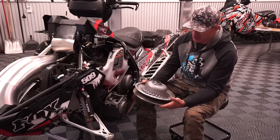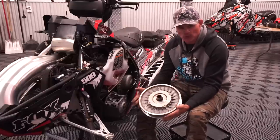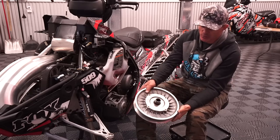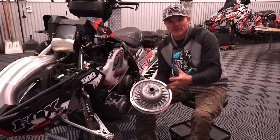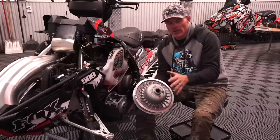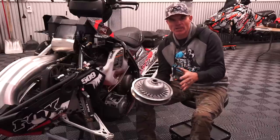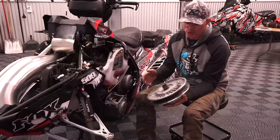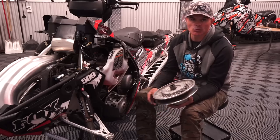For overall inspection of the secondary, cleaning these interior surfaces — it does have a spring inside of it. To get to that, you're pulling out these four Allens, getting into your Helix, and making sure that internal spring is definitely together. As a pre-season part of my checklist, I'm definitely going through my clutches so that I start the year with fresh springs, good belt tension, probably a new belt, and everything working properly.